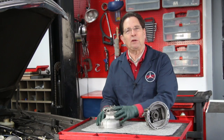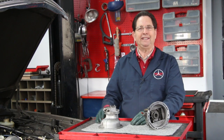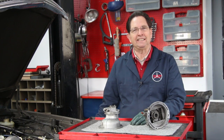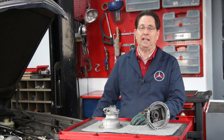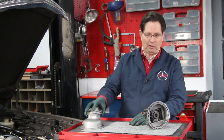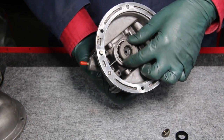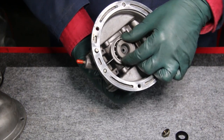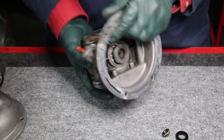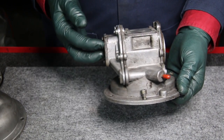In 1980, they went to a better design pump using a piston. But looking right here at a 1979 300 SD — in 1978, they introduced these five-cylinder turbo diesels, and they had one monster vacuum pump. Look at the drive mechanism in here: it is not a pumping action, it's a rotary action. And they have two diaphragms — look at that, two diaphragms.